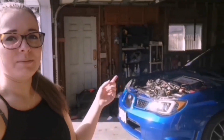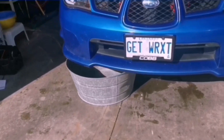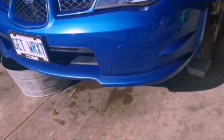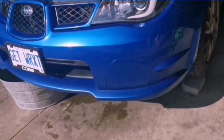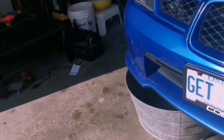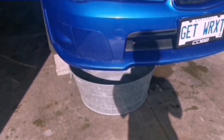The car's jacked up and we're pretty much good to go. First thing to do is start draining your coolant and your oil. I've got a big tub underneath. I'm pretty sure you could just pull the lower rad hose on this side, but it's going to come out way faster than I can control and I'll probably get sprayed in the face, so I'm just going to do the little plug and see what happens.